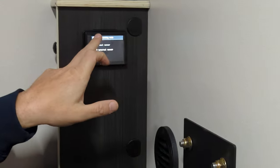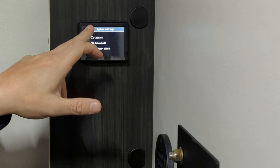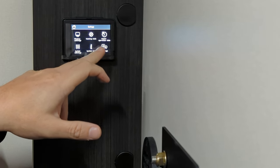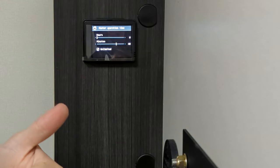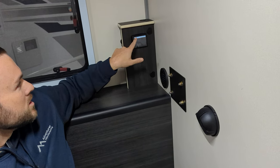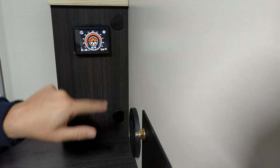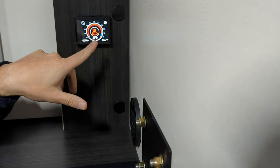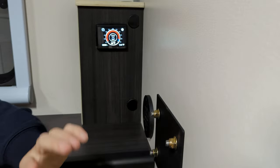In the Olympic and Kenai the external sensor is up above. Also go into system settings and change the unit to Fahrenheit if you're in the States, then go to display settings and set the heating operation to unlimited. Once those three changes are made — Fahrenheit, external sensor, unlimited operation — go back to the home screen. You can drag your finger along the temperature bar to set your target, like 81°F. It looks like a snowflake until you touch it, then shows like a coffee cup icon. Within five to ten minutes the camper will be warm; you can hear it firing already.